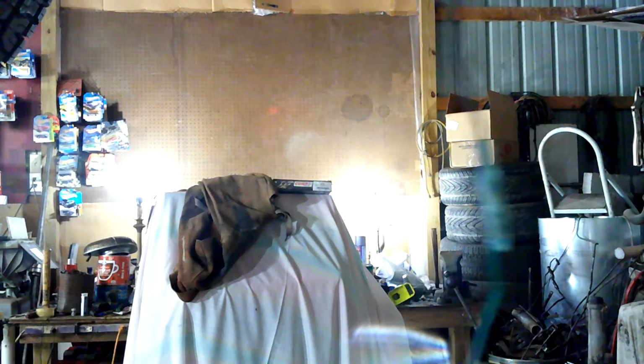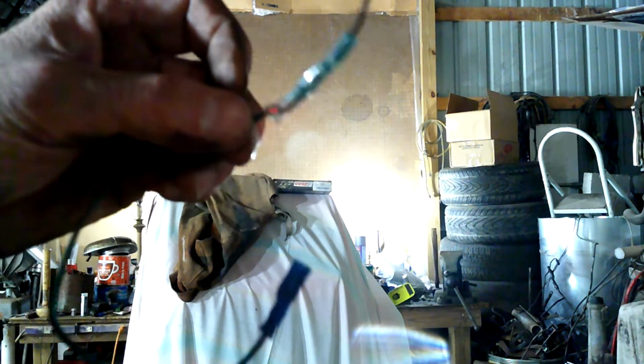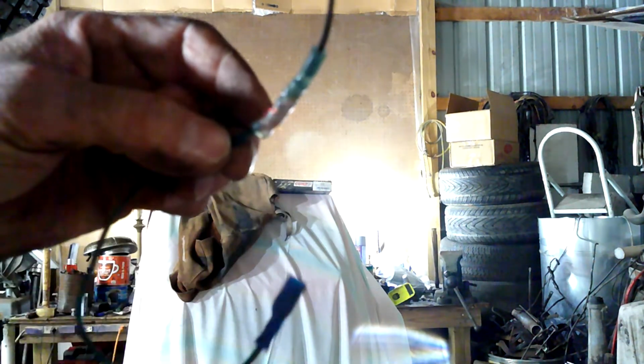And that's a whole lot better than just a regular crimp joint that can get corrosion. But if you'll see, up here and here, there's a couple of breaks in this line, but the wire's in good shape, just the insulation's a little sad. So I'm gonna wrap her with black tape anyway. Let's get the, ooh, that's hot. She is a warm one. But anyway, that's it. See, I bet y'all thought I was gonna go ahead and use that alligator clip. Nope, can't do that. But there you go. That's the right way, in my opinion, to fix it. And well, except for melting the plastic, don't do that. You can actually do it with a small torch or even a match if you want to. And then I'll show you how I'm going to put this on.